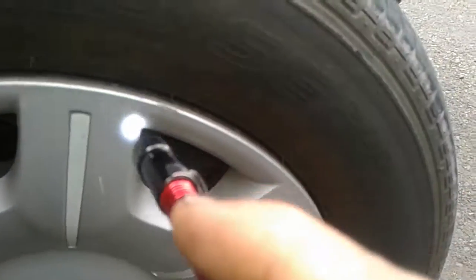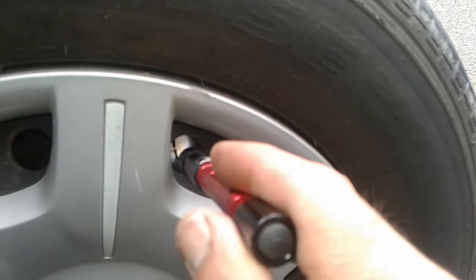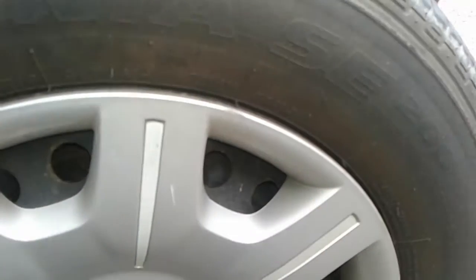Starting off with the right front tire and the front brakes. The front brakes are about 90%, or about 35,000 K left on the front brakes. So lots of front brake left on the right side. On your front right tire, the tires are down to about 30%, so you don't have a lot of life left on this front right tire. I would definitely be negotiating a set of front tires.